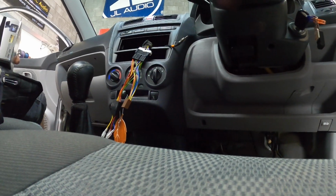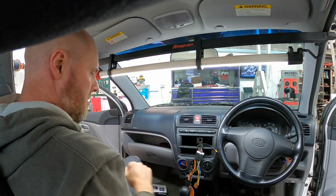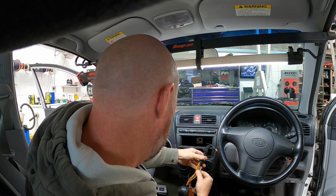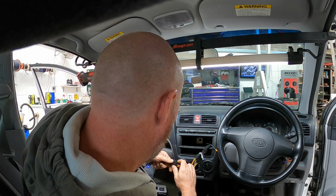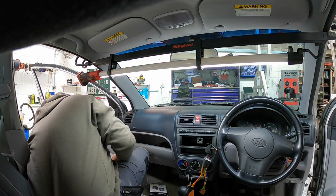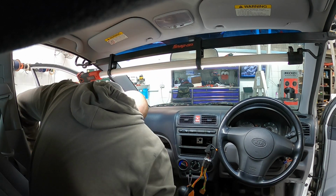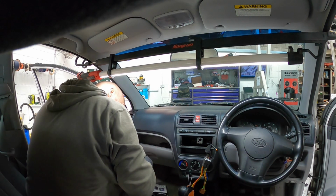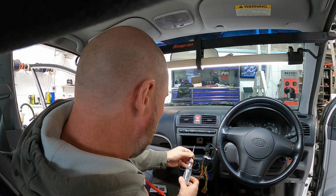We're going to go for the basics first. So, first things first. A radio only needs three things to turn on: live, earth, and ignition. So straight off the bat I can see an issue. Cheap cable. What the heck is that? I'm just joking. Let's get a decent earth and let's have a look what we've got.